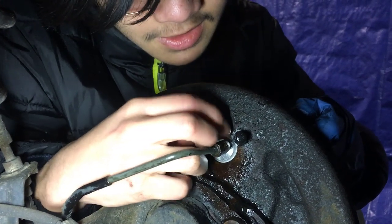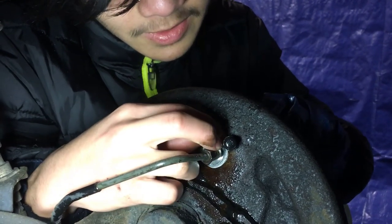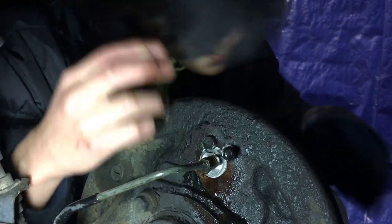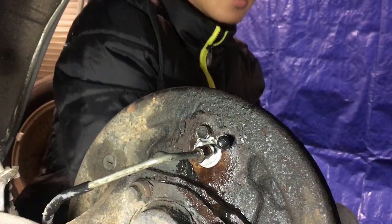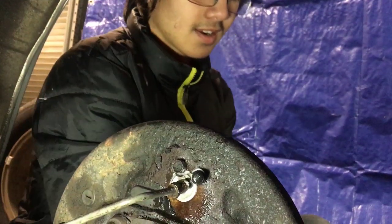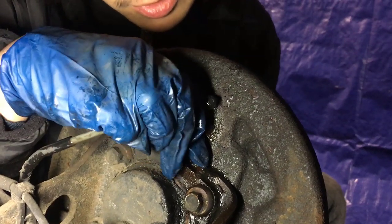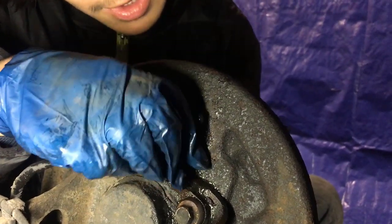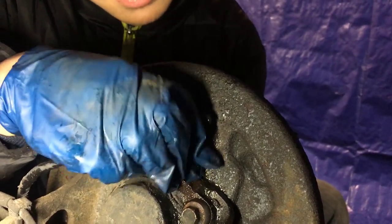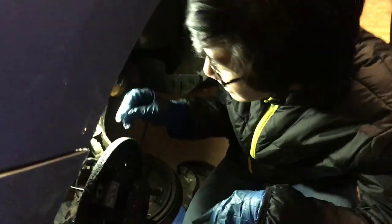I got it in. Now we're just going to screw it in slowly — maybe not tighten it all the way because we need a bit of wiggle room. I've secured it enough by hand. I'm going to put my gloves back on and we're going to try securing the brake line. After a bit of finagling, we figured out that in order to put the brake line in, we'll have to angle it a bit, then put it in and then put the bolt in. Make sure you don't cross-thread this — it shouldn't be a problem if you align it correctly.